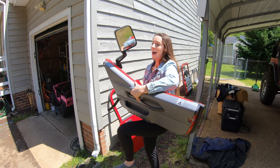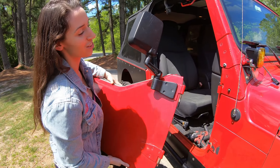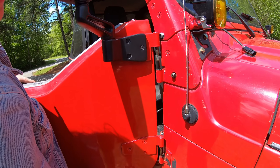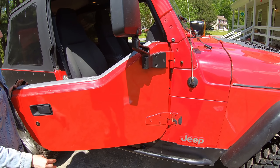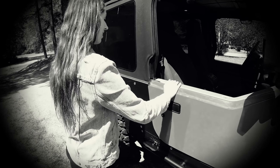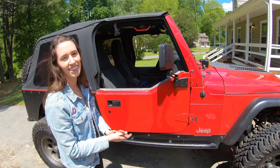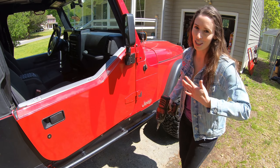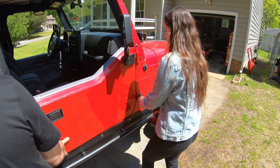We have the door hinge liners in. It would have been an easier job if ours weren't all rusty, so the key is doing it before you get to that point — otherwise it's a fairly simple job. There's no play — all the play is gone. But the door does not close — we need to adjust it down. That's probably because the new liners took up all that slack. We just loosen the bottom bolts and make the adjustment as needed.